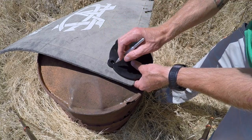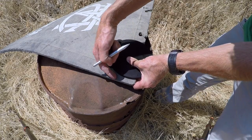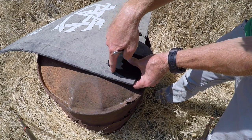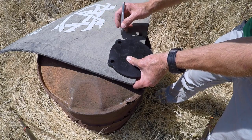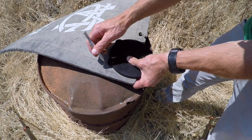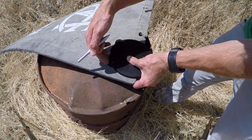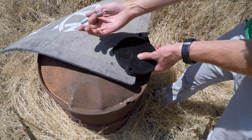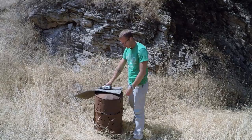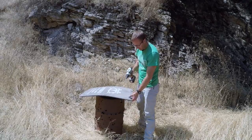The first thing I want to do is go ahead and mark where my holes are going to be drilled to drop my carriage bolt through and attach this thing. As you can see, I have space off to this side and leave some more space over on this side. It doesn't really matter — if your rounds end up hitting this, they're going to punch right through it. You don't want to make it too close because this is a weak point and this material is way weaker than steel. So as this gets torn up, even with a washer behind it, if you make it really close there, it's going to rip through and then your target's going to swing. So I'm going to go ahead and drill these holes out.